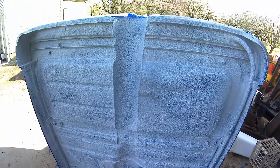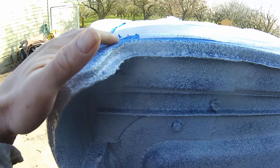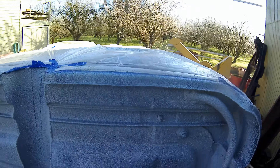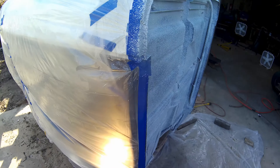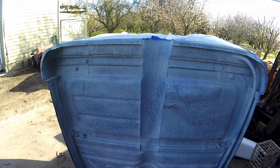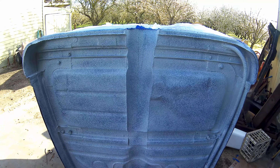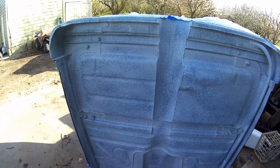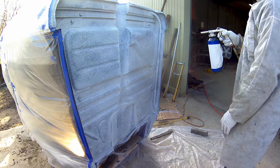This is what we've got today. We got one coat on yesterday, but Mrs. United States of Build came out last night and said it was time to stop working, so unfortunately we only got one coat on. The only problem with that is this stuff will dry over your masking tape and sometimes create a little bit of additional headache. So this morning we're going to shoot on our next coat. We've got a light on inside to keep the sheet metal warm from the back side — it's a little chilly this morning. We're still in our temperature window, but I like to have that substrate a little bit warmer. As far as manufacturer's instructions, they say just degrease and reshoot — no scuffing. And there's no reason to degrease since it didn't get any grease on it last night. So basically we're just going to mix up and start shooting.